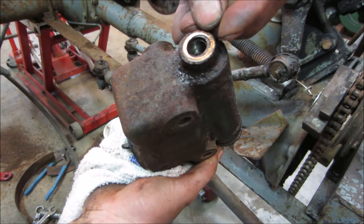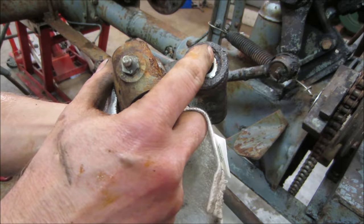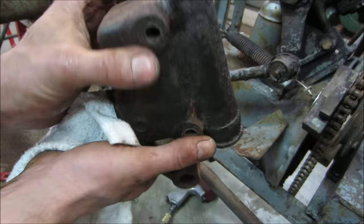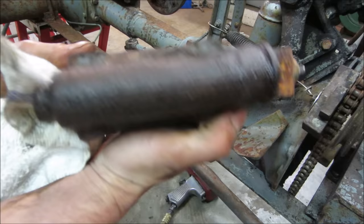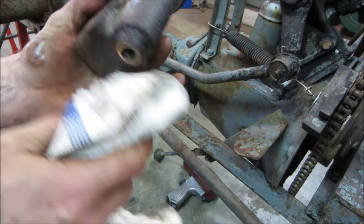So it's got a C-clip on this side, retaining the plunger. We'll do the same thing. We'll hit that with a wire wheel, get all the crap off of it. And I think we can probably put something like a rod down inside there and drive, see if we can get the piston out of here and what the condition of this is. Again, if it's savable or not. Yeah, it looks like it's got a part number on it too. I'm going to go home and look these up and they're going to be like 12 bucks a piece. Yeah, sure.